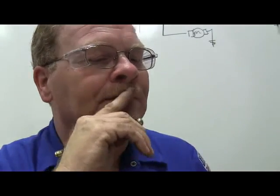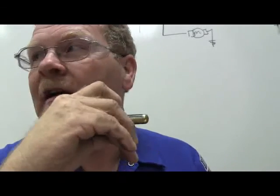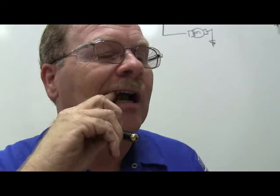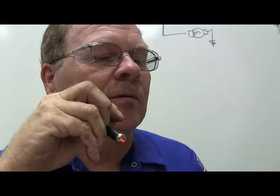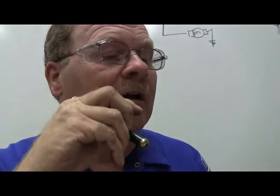Hydraulic pressure can be lost if brake fluid evaporates. Well, I didn't know it evaporates. Well, I mean, any fluid can evaporate. You know, steel will evaporate if you get it to 3,000 degrees. To obtain a medium weight fluid, mix DOT 3 and DOT 5. You never mix anything. Because DOT 5 brake fluid is polyglycol based, it's less likely to absorb moisture. Polyglycol sounds like antifreeze, doesn't it? Yeah. All right. Brake pedal fade can occur when brake fluid boils. Yeah. I mean, it's going to go down.